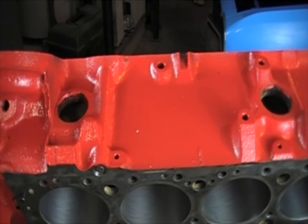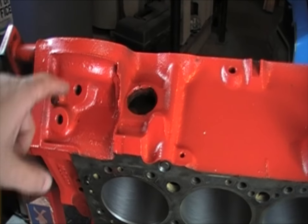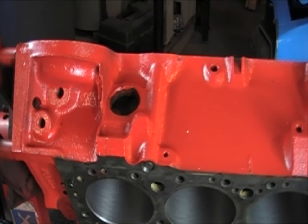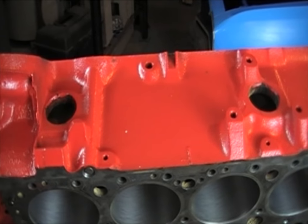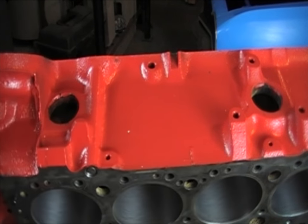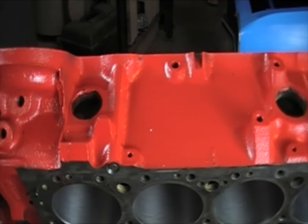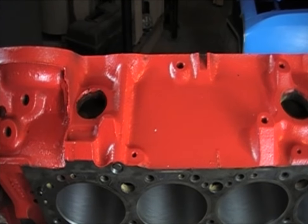As you go around the block, you're going to start to notice different bolts just kind of sitting along. You've got one here, one here, and you're just going to want to take these out — they're just basic Allen key bolts. One of them I had to take a 3/8 inch drive and file it down a little flatter to fit inside the square hole. These are just little quarter-inch bolts. It's probably a good idea to take the motor mounts off — you don't really want to tank your motor mounts. And then there's just another water plug or water plug sensor here.